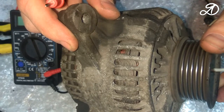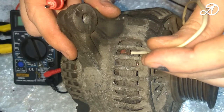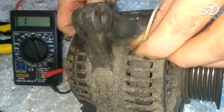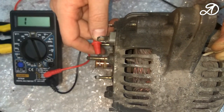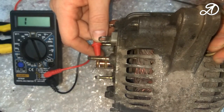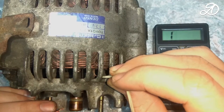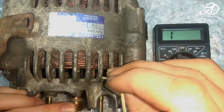The rotor housing can be reached through vents. Make sure that the probe is in good contact with the rotor housing. Continuity test of each of the contact rings on the housing. The buzzer should be silent. The contact was better at this point. Tests have shown that the rotor is functional.